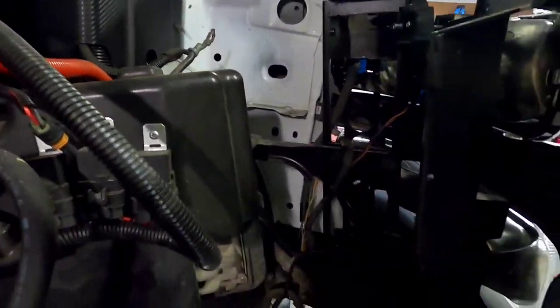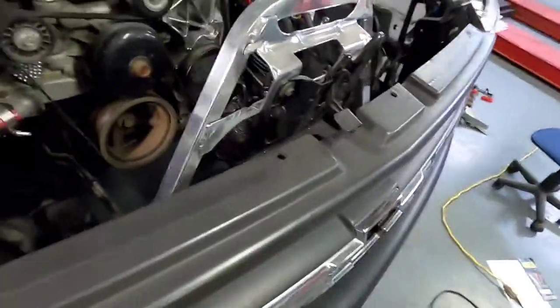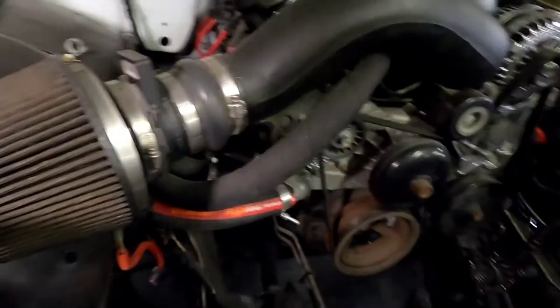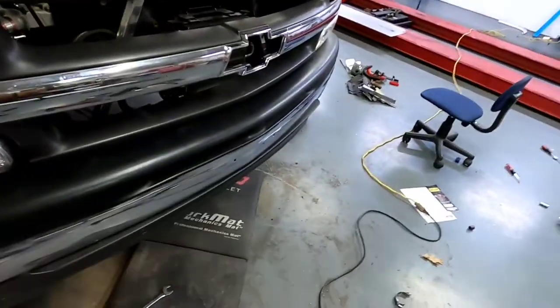I've gutted these down to see-through — you can see all the way through. The center section of the radiator support which was down here is totally gone. It just begins where the transmission cooler hinge hold-down fastens to it right there. The body bushing that held this up is replaced by a small piece of rubber hose like what I used to make the cooling lines with, and it traded two pounds for one ounce.